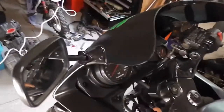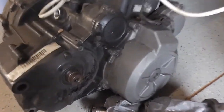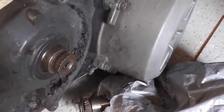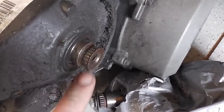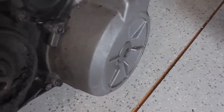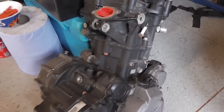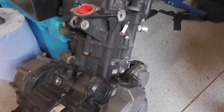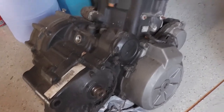The second new project is this BMW F650 engine. The output shaft is totally worn out - I think they welded the sprocket on it and then bought a new engine. I've got a new gearbox with a new output shaft, so the whole engine is going to have to be stripped down just to change the output shaft. That's a nice little project for us to go through.